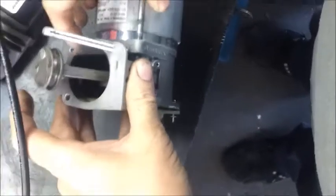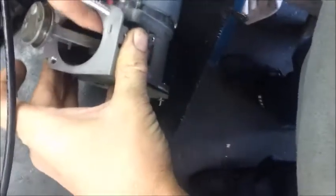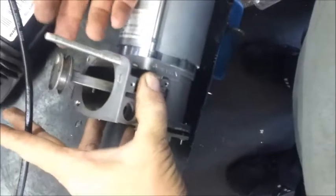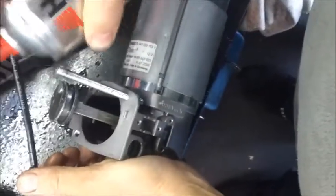At this stage it's worthwhile observing if you have a lot of old piston seal residue, dust, all around the piston head and inside the actual crank chamber. It's a good idea to clean out all the dust. You can use an air line to blow the dust out, and also I use some brake and parts cleaner by spraying the piston head and cleaning all the piston head assembly.